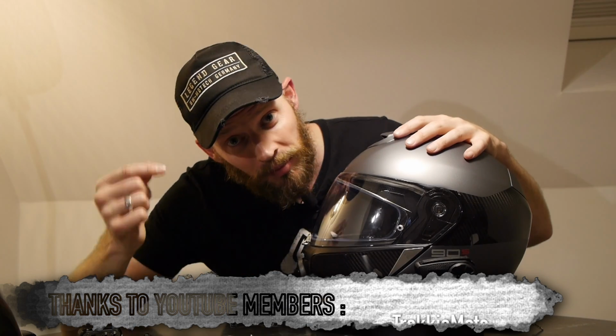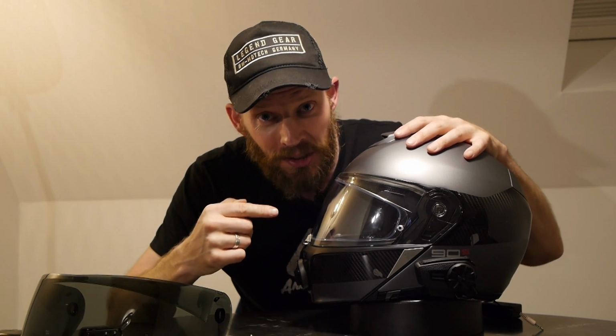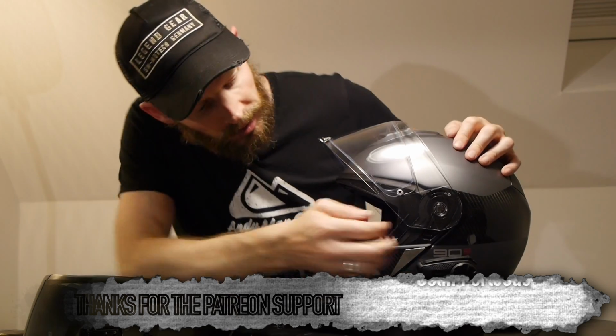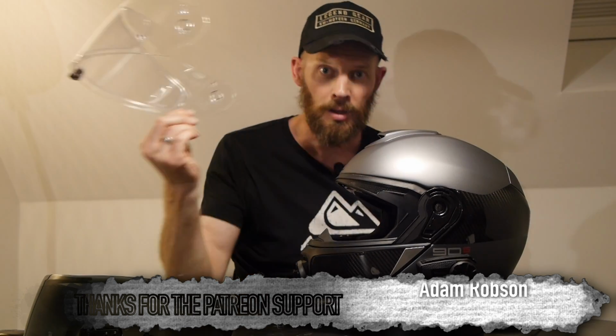So with the intercom, the camera, and the audio taken care of, there's only one thing left on the table to finish this whole thing off. That's the dark visor, which on these helmets, the HJC RPHAs, is insanely easy to change. Just flip up the visor, pull this little clip, the visor pops off, same on the other side over here, and the visor is off.